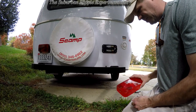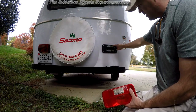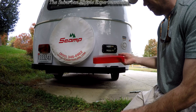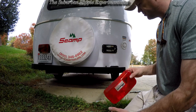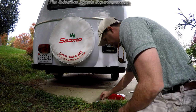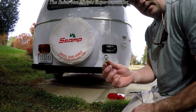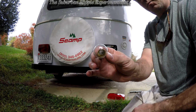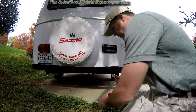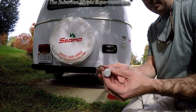I've taken the lens cover off the Scamp. Scamps have two bulbs in their tail lights — one is a backup light and one is a dual-filament brake light. This is where the backup light would shine, which I do not have wired up on this Scamp. The bottom one I think is an 1157 bulb — it's a dual-filament bulb, one filament for the tail lights and another that comes on when you hit the brake, so it's a little brighter.